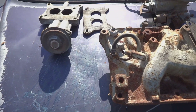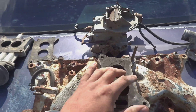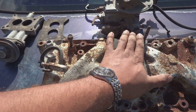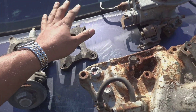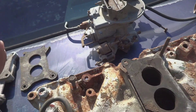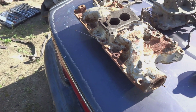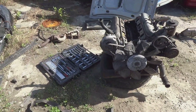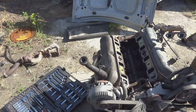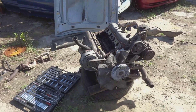I just have to put silicone on everything — silicone at the bottom of this manifold, silicone on the base of this carburetor so that it doesn't leak, silicone on both sides of this, and then silicone underneath the carburetor. I don't want any air leaks from the intake. I'll start putting on the silicone on the manifold, get it sitting on the motor, bolt it down, and then I'll come back and show you guys.